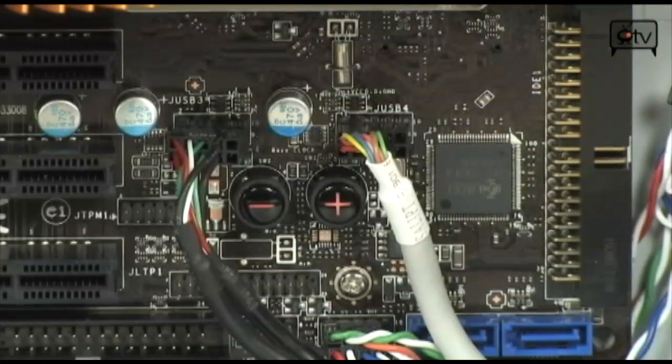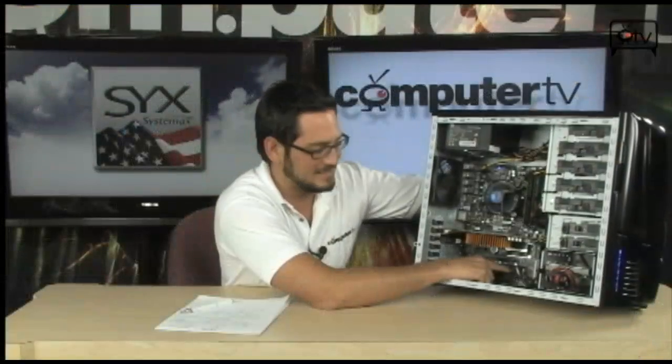This is a great way to establish your first initial base clock. You just push the button so you get a BSOD, and you back it off a few megahertz, and that's your base overclock. After that, you need to go to the BIOS to increase your voltages, and then keep going, but it makes things very, very simple.